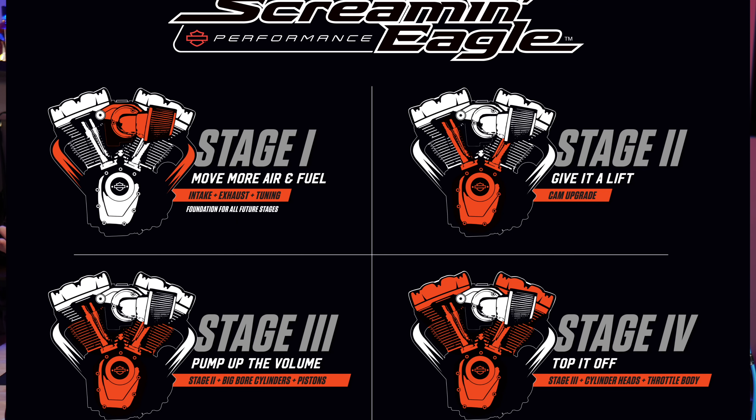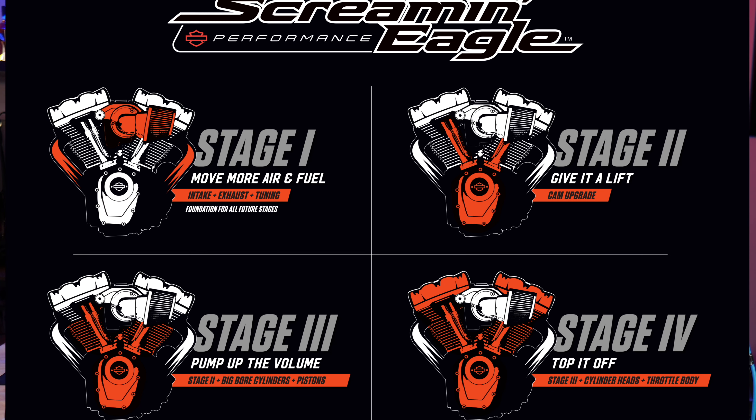As a car guy, especially in performance, you can kind of relate to this motorcycle stuff — it's kind of the same thing. Everything relates. After you figure out what the Harley tax is, you start seeing they have stage one, two, three, and four kits. This is the Screaming Eagle — Harley's performance brand — but there are so many aftermarket companies making all the parts, you don't necessarily have to buy the Screaming Eagle version. Stage one is going to give you increased airflow: your air cleaner, your exhaust, and then your tuning with the fuel pack.